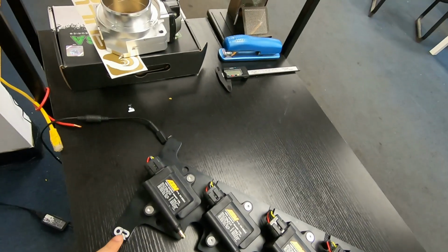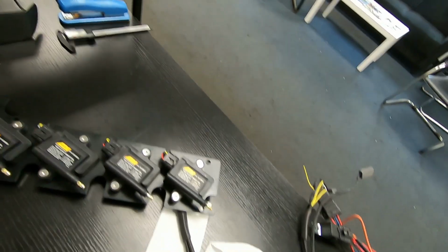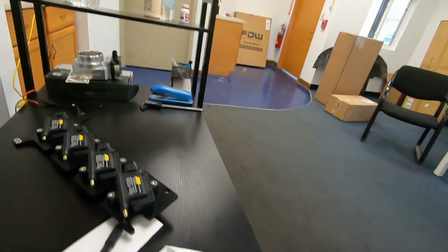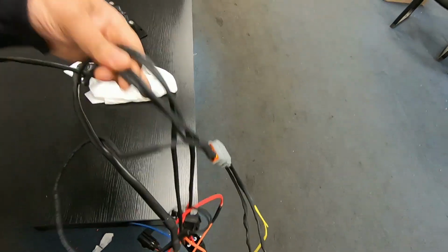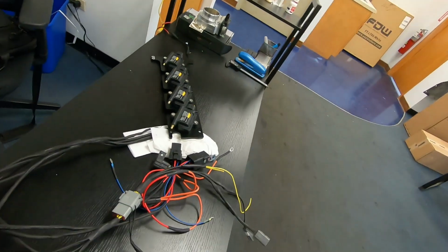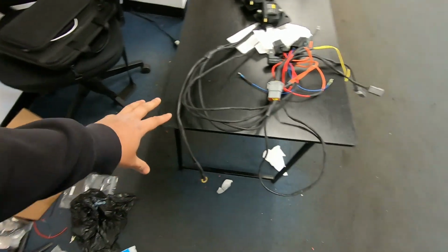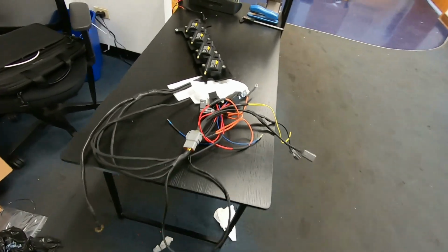I used Ohm Racing plates and AEM coils because he has AEM Infinity. And then I did the harness a little different on his. I didn't go with the braided lines or anything like that because he's going to have everything tucked. So I extended everything and basically did chemical resistant coating and fire resistant, fire retarded sleeves, which is stiffer, but again, everything is going to be tucked.